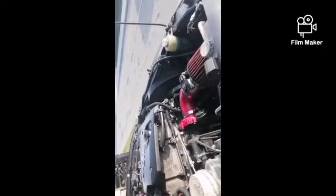Give a little blast. Please like and subscribe if you like the videos I make — it's a journey. There's a 3-inch front mount fitted, 600mm by about 425mm something like that. It's going to be an eBay special, so nothing expensive. I'm going to open the front out — I'm happy with the exhaust for now. Eventually I will get on that downpipe and make a 3-inch back into my custom back box.